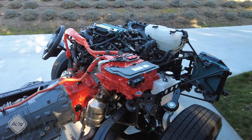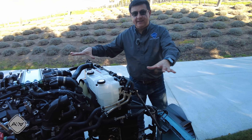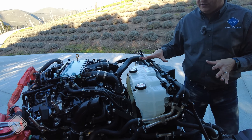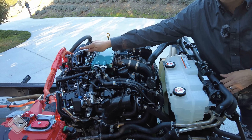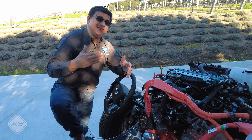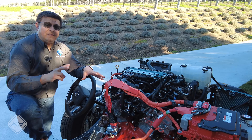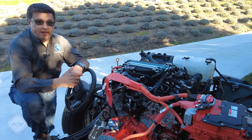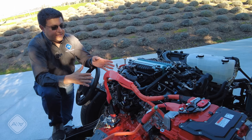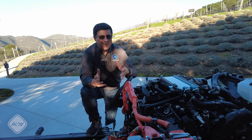The most interesting thing and probably the biggest thing to know about this hybrid system is that this is exactly the same as a regular twin-turbo Tundra, except for the addition of these orange components. And this is the main reason that the fuel economy in the Tundra hybrid is not as high as some people might have wished for — fuel economy improvements are, on average, 2 mpg combined better than the non-hybrid standalone turbo model, and the big difference is in city driving, not highway driving.